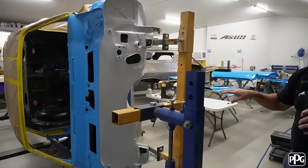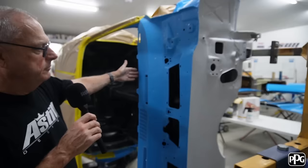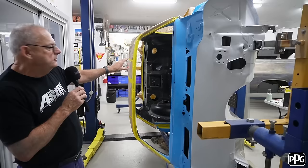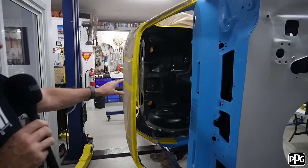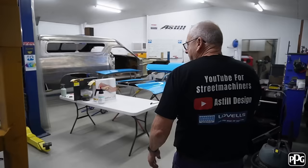Now I'm going to paint the underside. I'm going to stone guard the bulk of underneath, but this area here the guys up there just put some blue on it to seal it up. This will be satin black all the way through. I've got all this rubbed with 800 — we did that yesterday — so that's pretty much good to go. Then all inside I'm just going to put some CF black on it. Adam's going to put some sound deadening inside, so there's no need for us to put any stone guard on the interior.